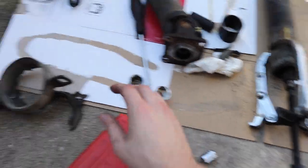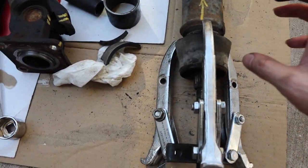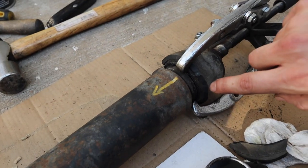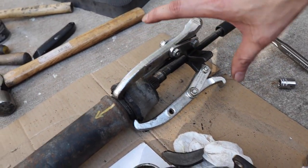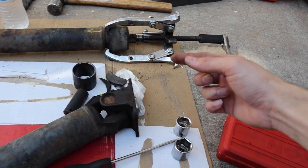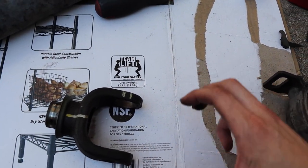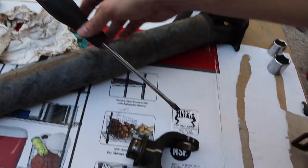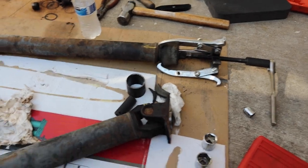I came over here and cut off the remainder of that carrier bearing, put it to the side, and cut off as much as I could to reveal the metal piece underneath. Remove all of that so you can grab this metal edge, which is what you're going to pull to get the carrier bearing off. Before we got to that point, we did have to take this out. The way I did it: with the puller I basically made it into two jaws instead of three, put it on the sides — being very careful not to mess up the inside — then twisted it until I was able to pull it off. It was a little short on the bolt side, so at the very end I just came in and lightly hit the edges on the outside with my flat head screwdriver, and I was able to take it out.